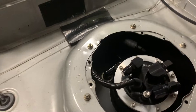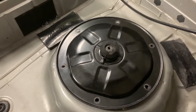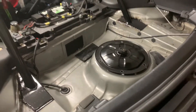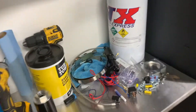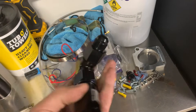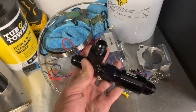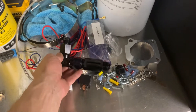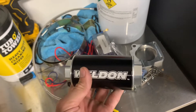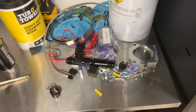So I'm actually going to throw this bad boy back on here — found it from a long time ago, cleaned it up. Hopefully this will make it a little quieter inside the cabin when I'm street driving this thing. I'm going to toss that on, probably wrap it up for today until I get the rest of my parts. This was going to be used for the priming pump — the primer pump would feed into here, there's a check valve so it can't flow back into the tank, and I may use that down the line if I have trouble starting it without it. And then another inline filter — this is a 100 micron just to make sure no big contaminants go into the mechanical pump, and then obviously there's still the injector dynamics filter after the pump before the rails.